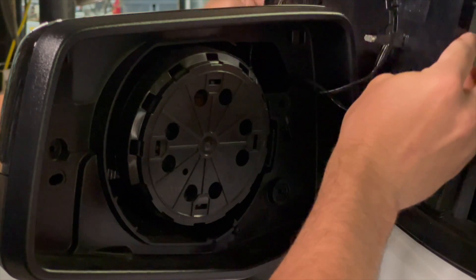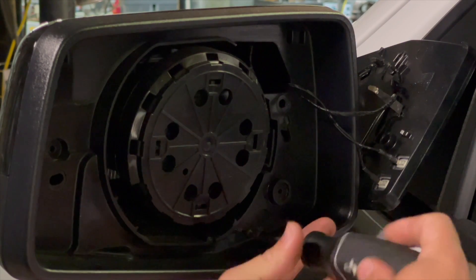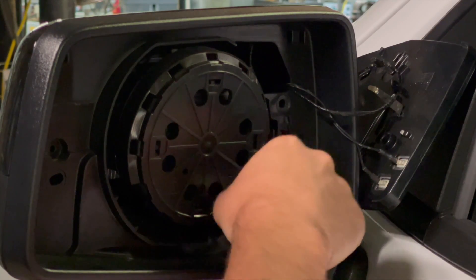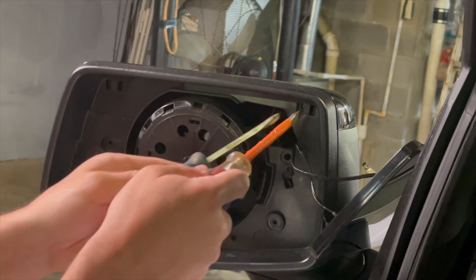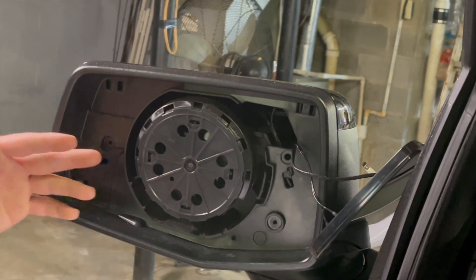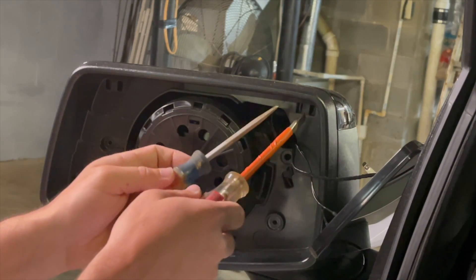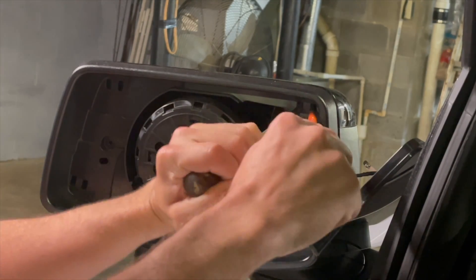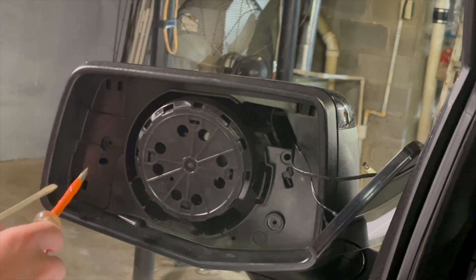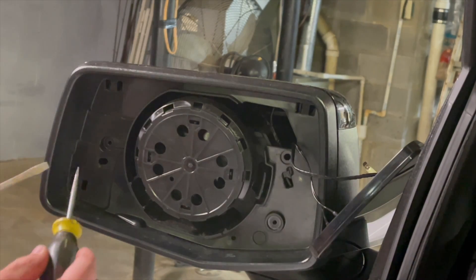Fold that up out of the way — right here, that's the one and only screw in this mirror as far as what we're taking apart. Now this part can be a little bit frustrating, but essentially we're going to be taking two flathead screwdrivers, prying in here, here, and here. I already did the other side so I was aware — on the other side it had something holding it right here and it just pulled and popped free, nothing broke. Sometimes these tabs don't want to exactly pop out, but you're essentially just going to push them in towards each other and wiggle them.